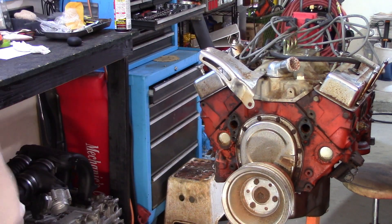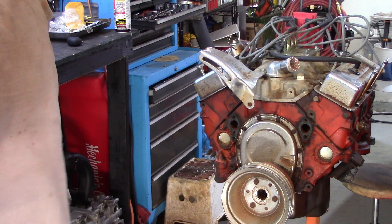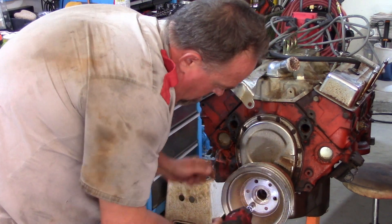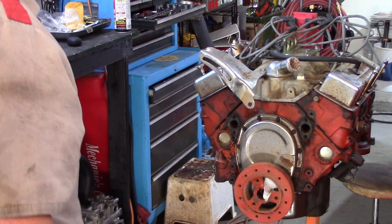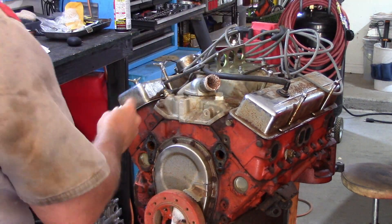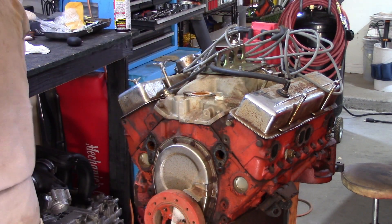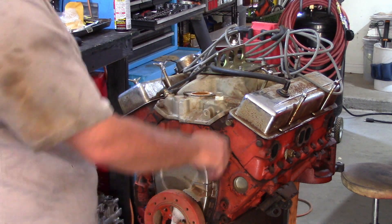Next I'm going to take off that crank pulley — there's one big center bolt in the middle, and then three smaller ones that attach the crank pulley to the harmonic balancer. We'll get that going. You can see my Porsche Boxster engine sitting on the floor — that's going to eventually become a coffee table or something. Now the pulley's off. We found cobwebs inside the harmonic balancer. The bracket comes off next, and then the thermostat housing — with no thermostat. Look at that corrosion.